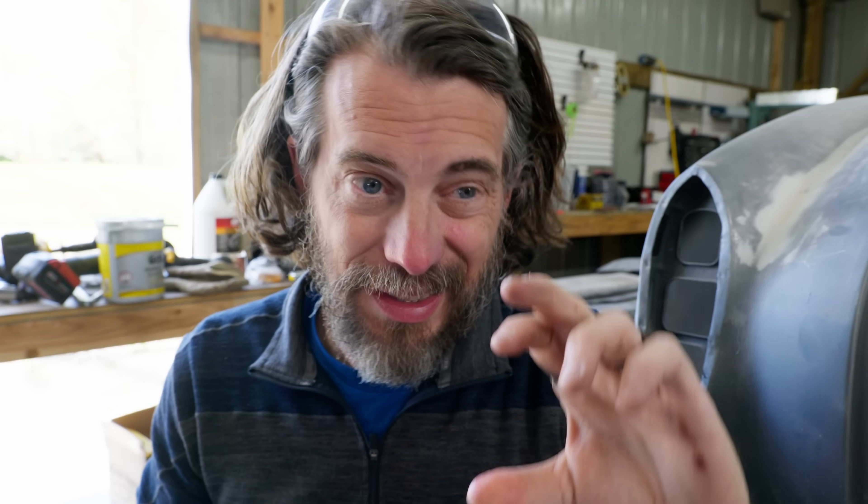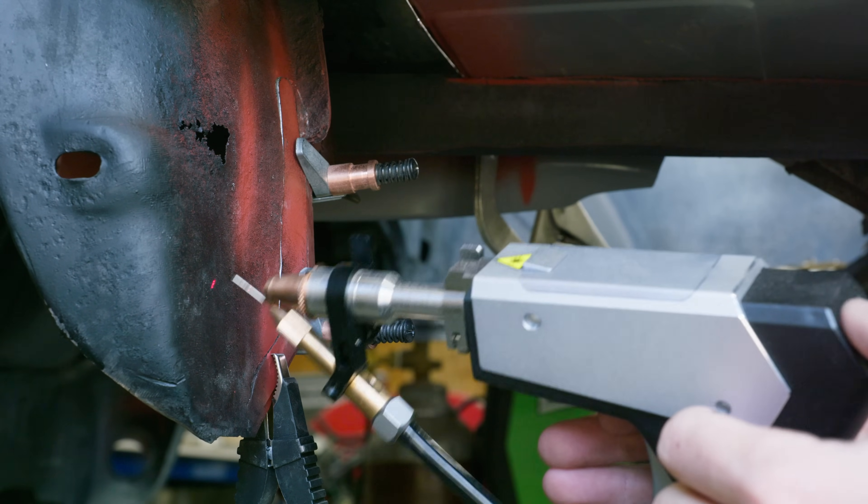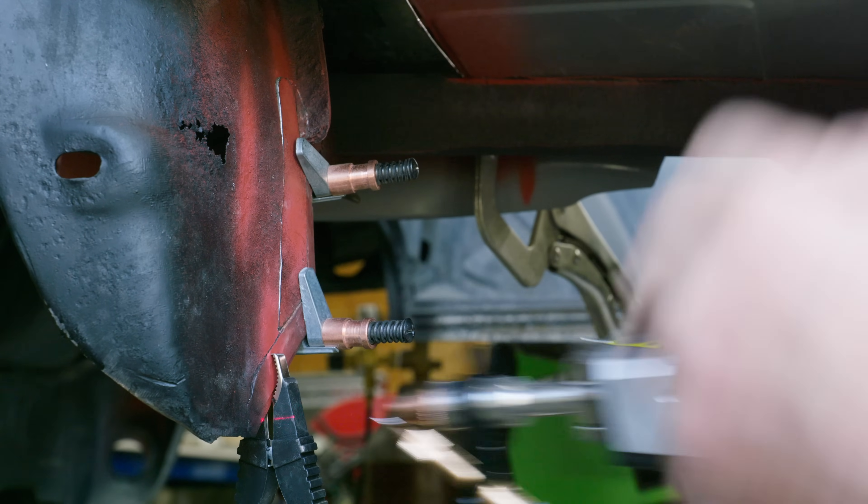The thing I'm actually having trouble with is getting these tiny little patches to fit in the hole. It takes me a really long time, more than I would like to admit, but I think I have the first one ready to weld in. We're going to test putting this piece in and just tack weld around so we don't get it too hot. Luckily the Metal Fab has a tack weld setting that will control how long it welds, so you can pull the trigger and it fires, and you can set that based on the thickness of the material — that sounds pretty awesome. It also has a wire feeder that you can manually control.